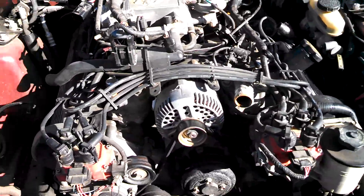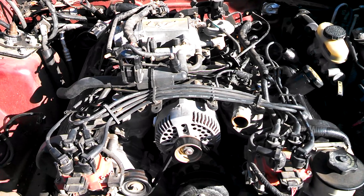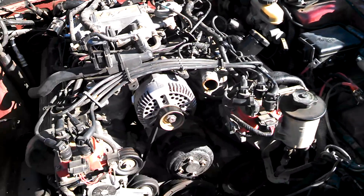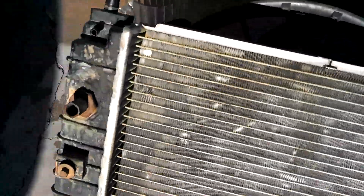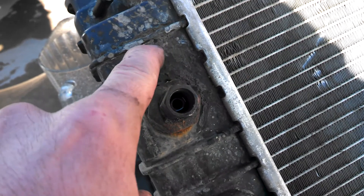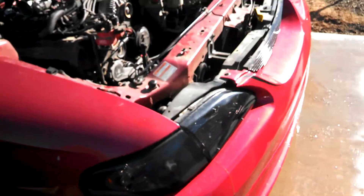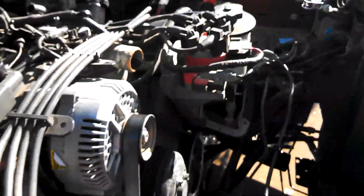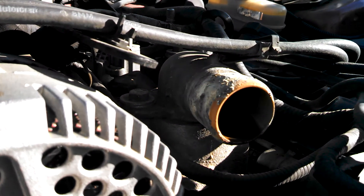So your motor is blown — I understand that. You don't want to spend money on coolant. Just don't drive the car then. If you absolutely have to, go ahead and spend the money on that $15 jug of coolant. Because now you have an issue with your radiator. Your radiator is going to show rust — you've got rusty, nasty coolant. This radiator is already starting to seep right around the tanks here, and that radiator is pretty much done. You can see that rust all inside — that's just nasty. That's not good for your engine.